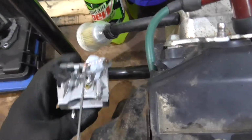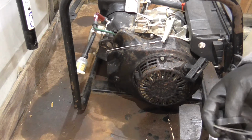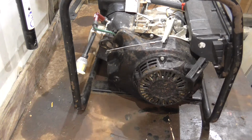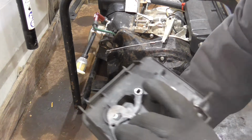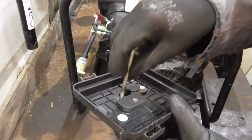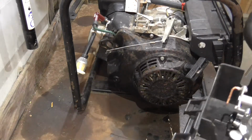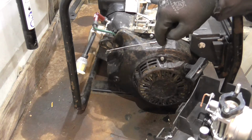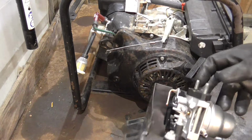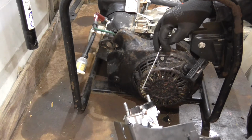So, anyway, carburetors. This one. That one will go on the outlet. We'll need the space. So, yeah, slap this thing on, see what happens. I've got to stack up the carburetor on the air filter first, and I've got to remember which way around all these gaskets go. I have to thread them through there, and I keep dropping the bloody things. Technically speaking, this insulator is for the original carburetor, which I could buy, because this engine is a clone of a Yamaha MZ175, but I'd also have to buy the proper air filter probably, and spending about 25 quid on this thing?